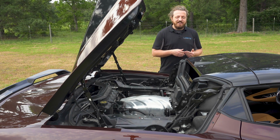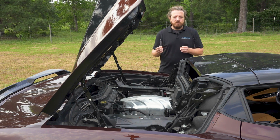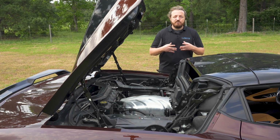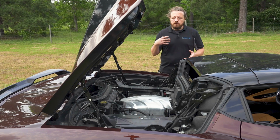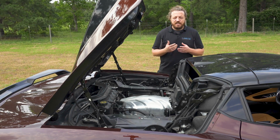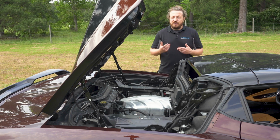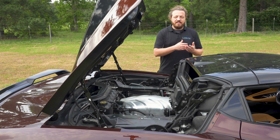So what Late Model Engines does is they add these provisions or these snorkels in the valley, which adds a lot of crankcase ventilation and allows the crankcase to breathe, and that goes up through the valve covers and into our catch can system. So that's a really cool thing that not a lot of other machine shops are doing with the LT2, so that's one other feature we really like about it.